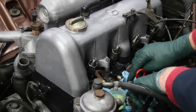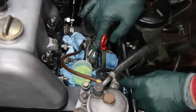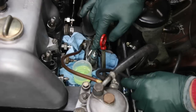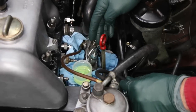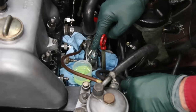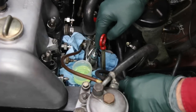I'm going to explain a little bit about the challenge of doing injection pump timing. Here you can see I've set up the drip tube and I've got this little container to catch the drips. I know a lot of diesel owners have been very frustrated trying to set their injection pump timing using the drip tube, because if you follow the instructions in the Haynes manual or even in the factory manual, it's a little confusing and unclear, and a lot of owners report never being able to get it to drip like it's supposed to.